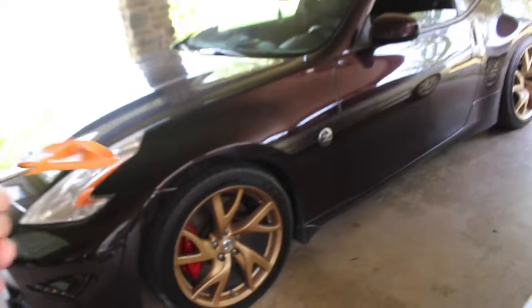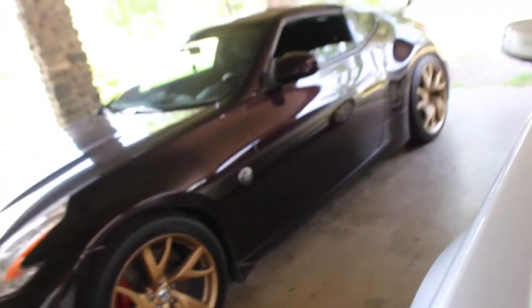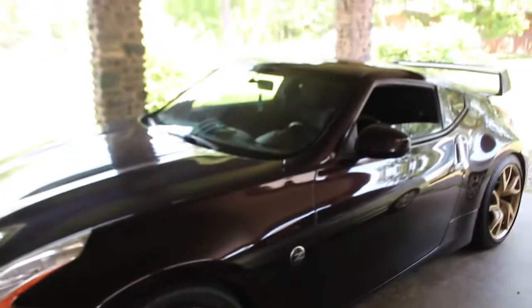This clutch has about 94,000 miles on it, and so far it's been good until I hit 90k, because when I was trying to race my buddy with a 5.0, I was slipping in third and fourth gear pretty bad. Then after that, my clutch got really hot, and first, second, third, all of it just started slipping. It just went bad when it got hot.